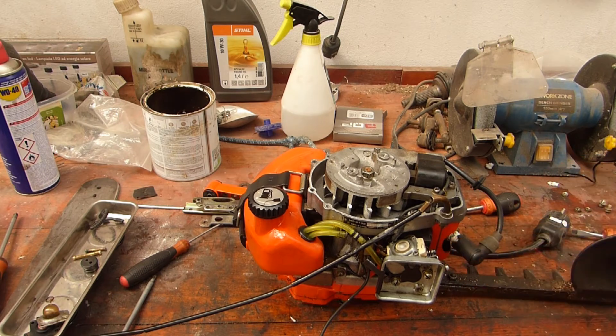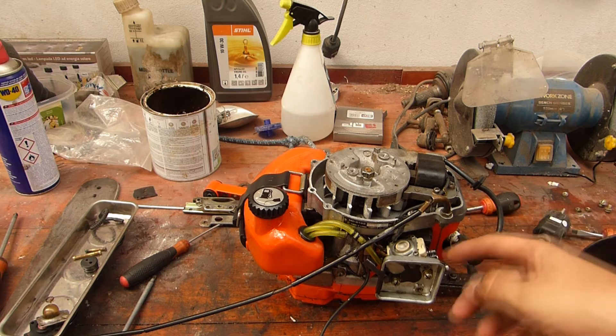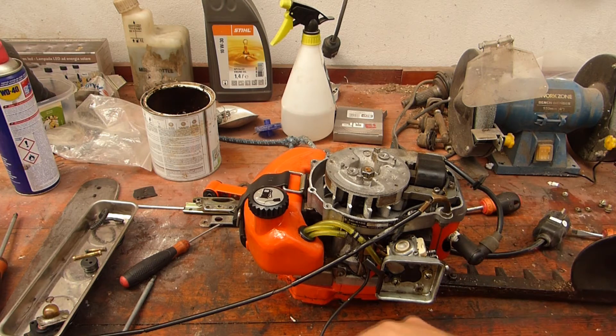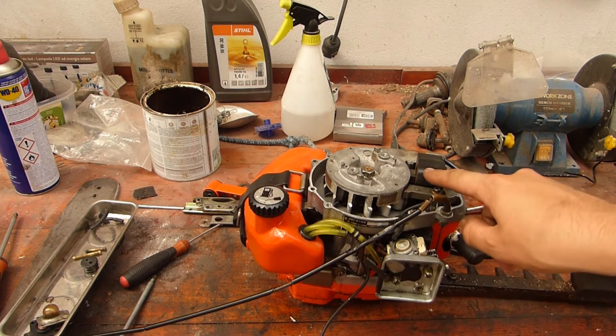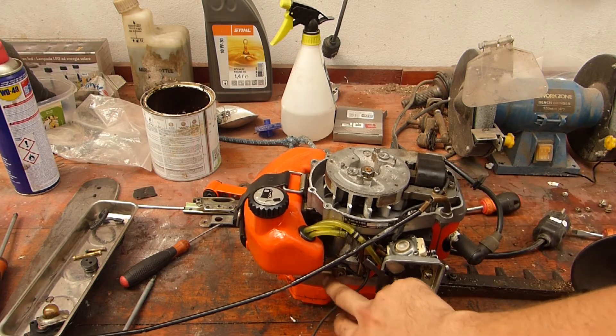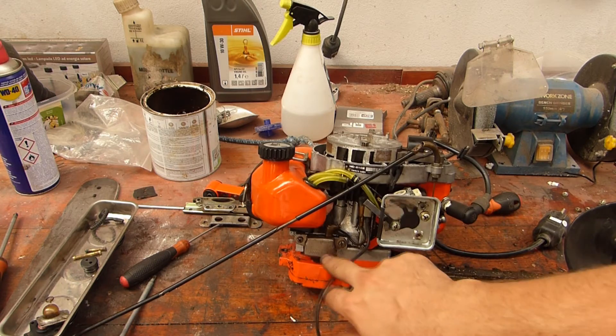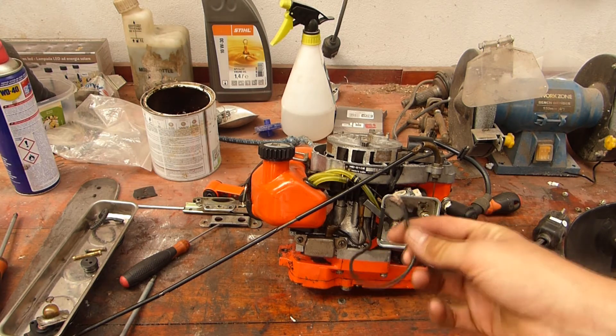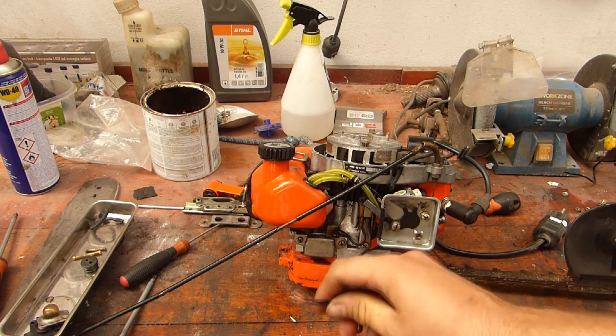This is how it looks, how it is, even though it does look strange. I've repaired the wiring as there were some broken connections. I've added some new wires. I've improved the connection with the module because it's electronic ignition with an external module over here. There it is. It does work — I do have spark. This is the cable that would go to the stop switch.